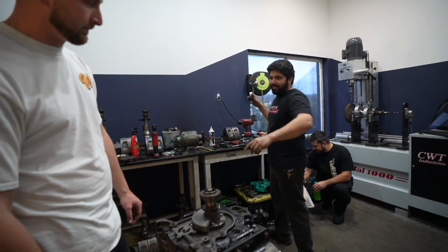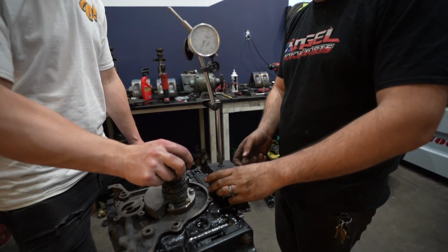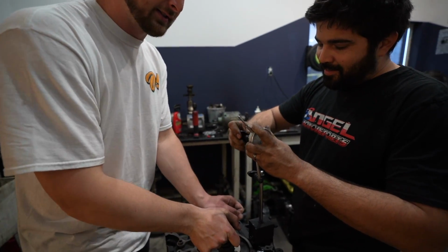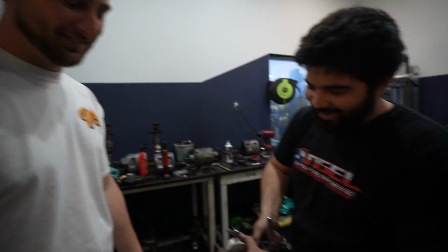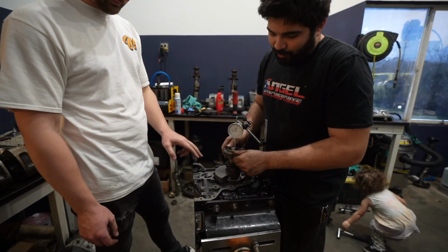By feeling it right now, it feels good. Like up and down. Yeah. I don't know if you try pulling it up and down, because we want some lash in it. How much do you want? Because this feels like between 2 and 4. This feels like 3. I'm feeling it. Yeah, it feels like 3. Look at that. So a little under 3, so that's good. 3. That's what we want. Felt that. Yeah, that's perfect.